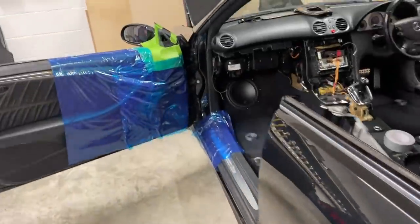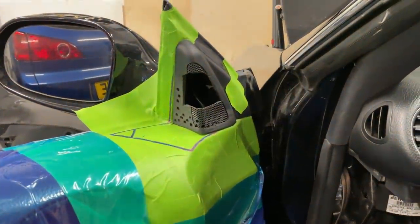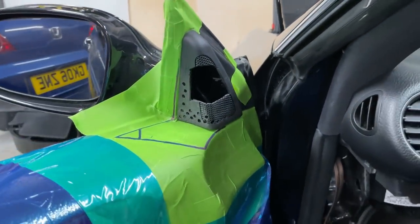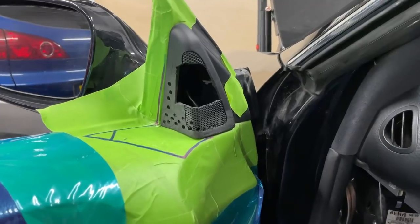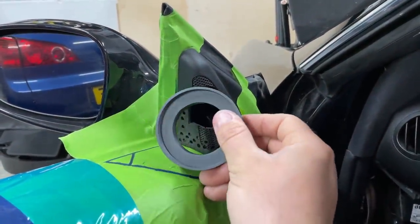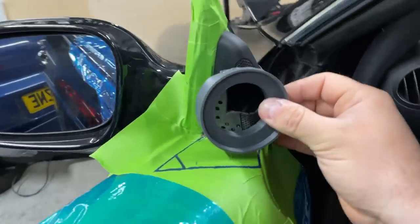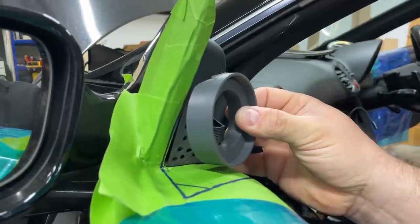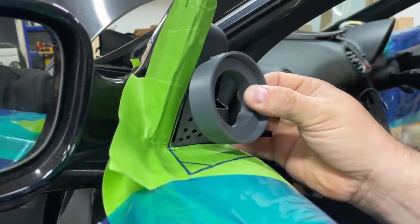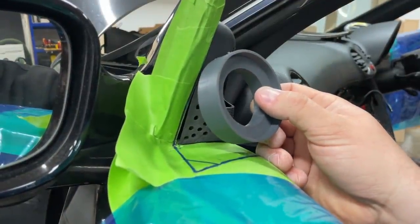So, before I start making a move on this, let me give a bit of explanation about the sails. If we used small format, tiny little tweeters, then we could potentially just build straight into the sail panel, which is not big at all. But because it's a slightly larger tweeter, we 3D printed rings for them. I shaved a bit out of it so I can push it even further out. We need a bit of extension to the platform, because let's say you could mount it like this, but then it aims a bit too low. In order to make it the desired angle, it comes away from the trim, and for that I have to extend the platform. Then I can create a more flawless shape.